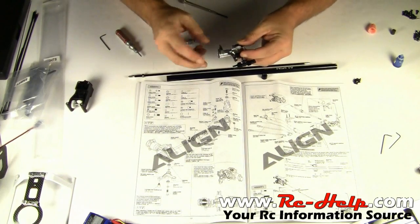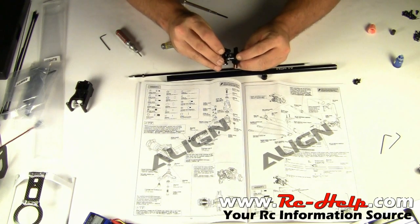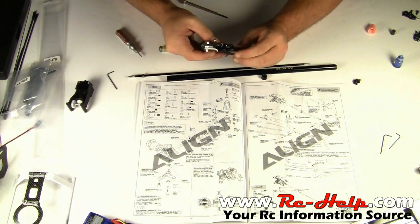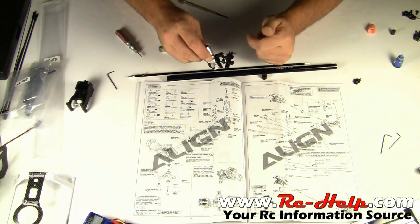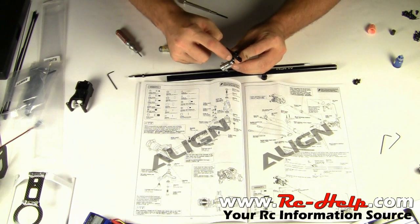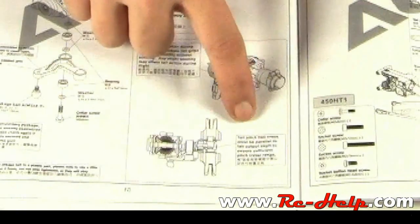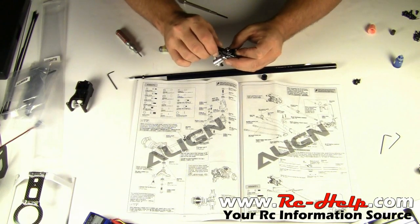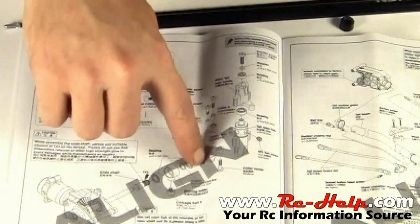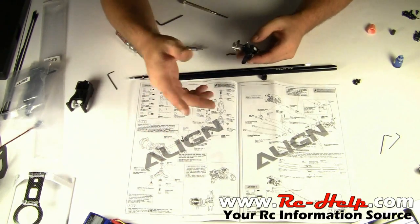I went through every single screw, taken it out and redid it. This little grub screw in the side was so unbelievably tight that I thought I was about to break it — I'm almost positive I would have stripped it out. I was able to get it out, re-threadlock it, and everything is still nice and smooth. It spins nice and free. When you put this back together, make sure the center part comes out flush with the tail shaft so you can get the most amount of pitch. None of these screws were tight — some were loose. Make sure you go through these and put threadlock on them.